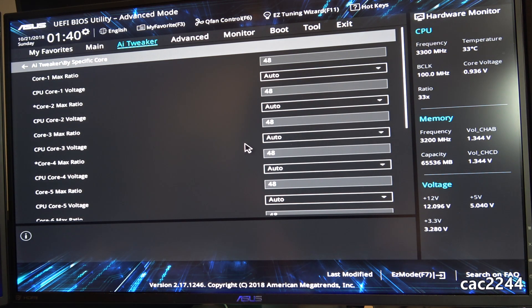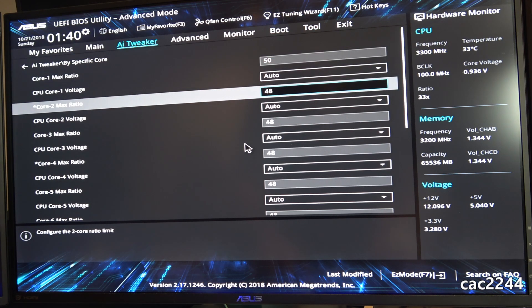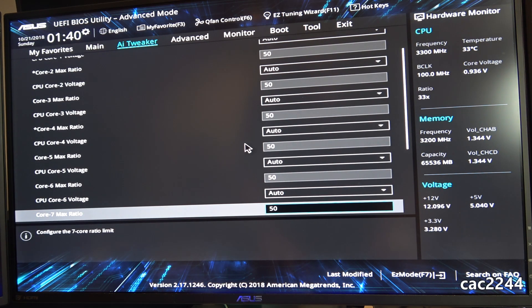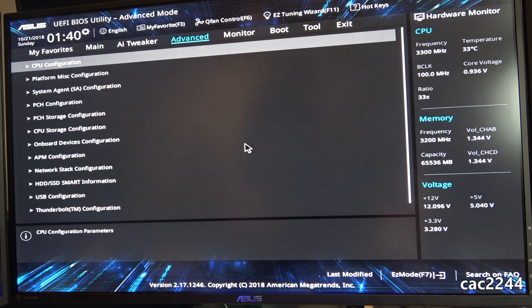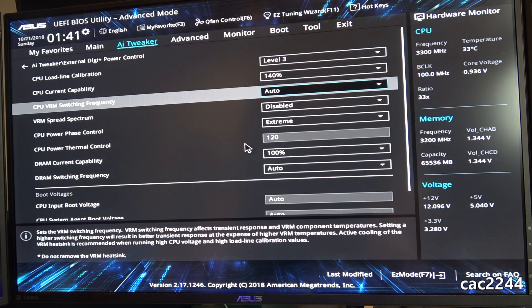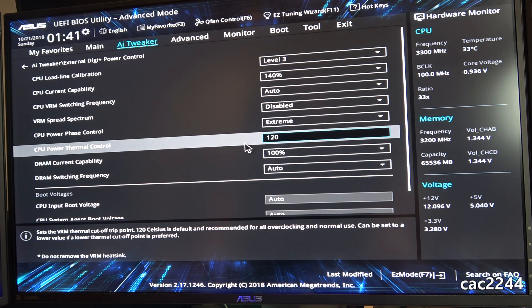In my case, on the first and only passive delid, I gained exactly 20 degrees Celsius. I went from a maximum core temp of 93 degrees Celsius at 4.4 GHz on all 10 cores, down to 73 degrees Celsius after 30 minutes of a Blender benchmark. Averaging all cores based on benchmarks recorded by HWinfo, I also saw the same average 20 degree Celsius reduction across the board.